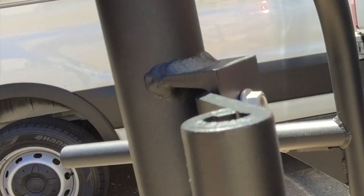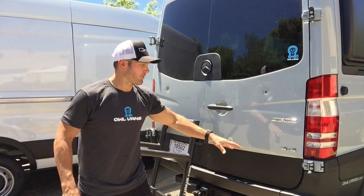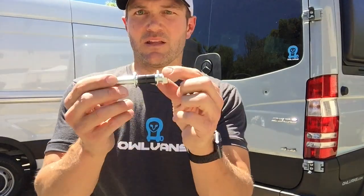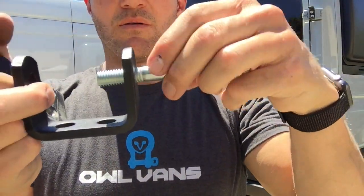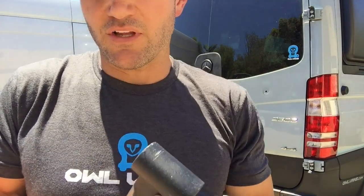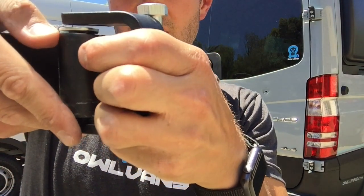Put the short one on top and the long one on the bottom. Once you have your hinges on your vehicle, you're ready to mount this up onto the van. Once you've got both hinges installed on the upper and lower bracket of the bike rack, you are ready to actually put it on the van. You'll find this bolt — it's got two regular washers and two plastic washers. Everything goes inside of this C-channel. You've got this already on your rack — a plastic washer goes in one side, a plastic washer goes in the other side, and then you sandwich them with the metal washers.